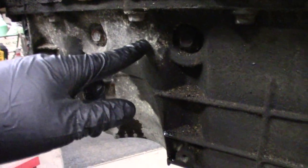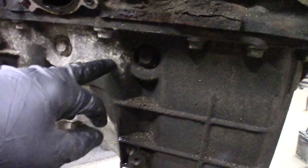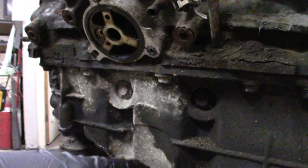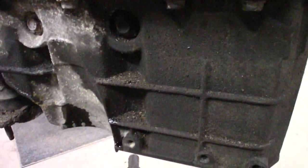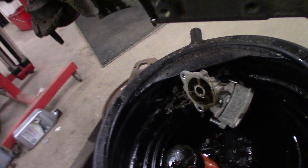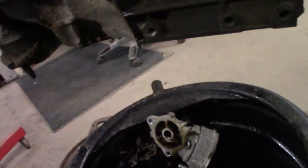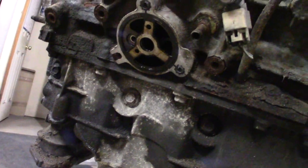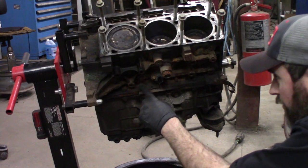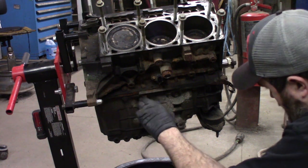I would like to put a turbo on this motor eventually, but I don't think I'll have room for the turbo drain where I want it on the side. With the adapter, what I can do is get rid of the oil cooler since it's broken anyway — I won't need it. I'll take that apart next and have a look at how it's set up, see if there's any way to avoid having a filter on the edge of the block. I'll also pull this coolant plug out from around the walls to drain the remaining coolant.